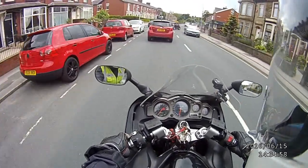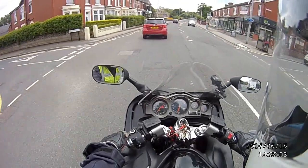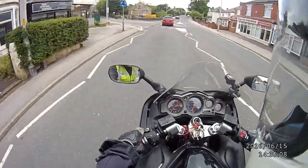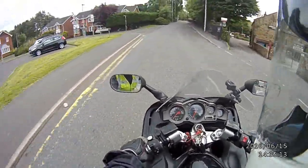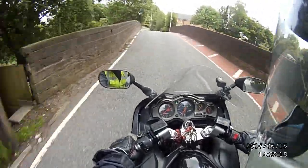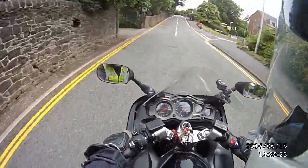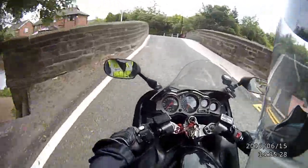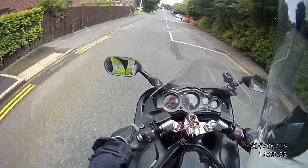So I had the pads out, just cleaned up the pins, lubricated the pins, and generally took the crud off them. I don't know how things are working out early at the moment, so it's a bit of a brake test as well. The front brakes seem to be alright. The back brakes seem a bit unusual, but I suppose they need to bed in again.